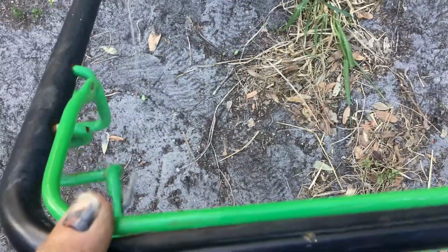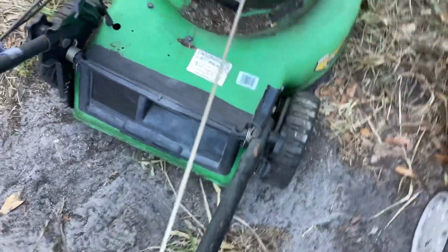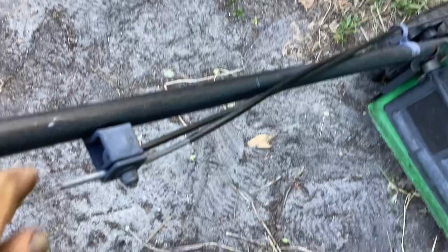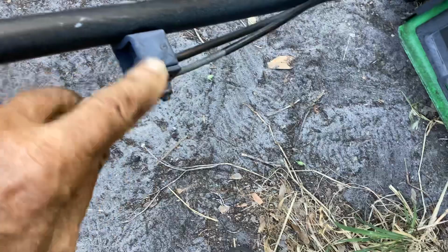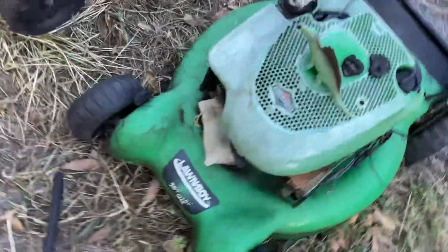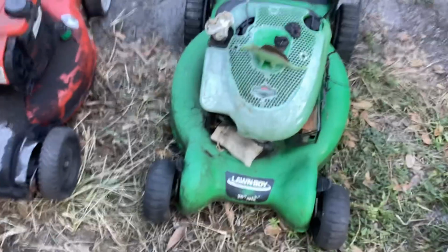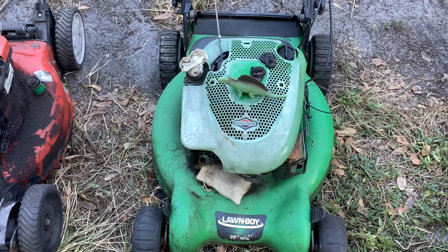So we need a cable for this. I went to engage the drive, and you can see all this slack. I didn't get any action on the drive wheels. For shits and giggles, 11 millimeter, I'm gonna go ahead and take some of this slack out, start this crap box again, see if the drive works. If it is, this might be something to concentrate on. Remove all this nonsense and get the right cable for it.